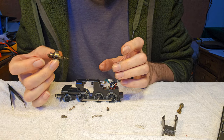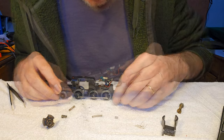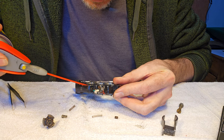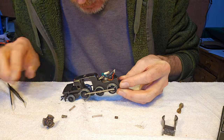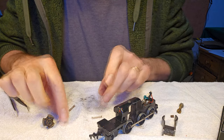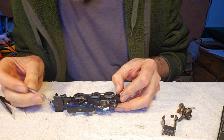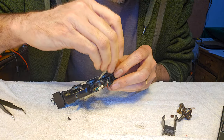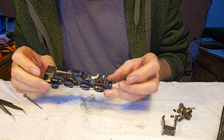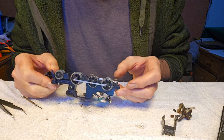The armature then comes out. Is the ball bearing in there? Can't see it. I can't see the ball bearing in the other one either. Yeah, I think the ball bearing is in there — just not wanting to come out. Let's put these to the side. To get these brushes out — there's one, and there's the other. So I think we just need to give this a really good squirt with the contact cleaner, get all the oil off it. We'll solder that back up, re-magnetise it, clean it, put some fresh lubrication in. I think it'll be okay.